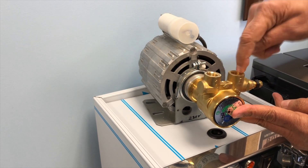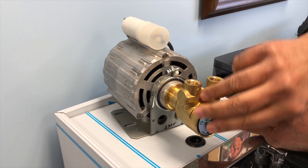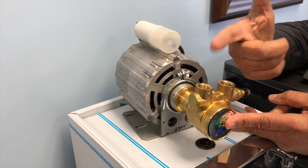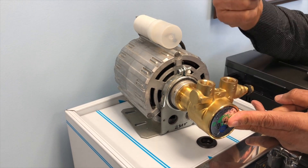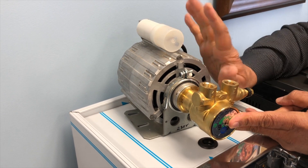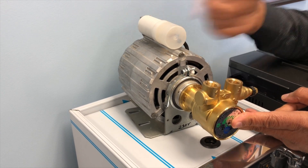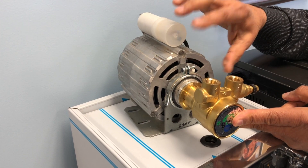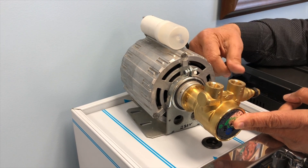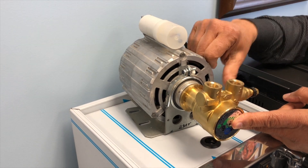One side is the inlet, the other side is the outlet. Inside the chamber there is a rotor to which five or six vanes are attached — they will turn and push the water and pump it into making espresso. This motor will operate on the same circuit as the solenoid valve which allows water to come into the machine, so as soon as the motor starts, the solenoid valve will open and allow the water in, either to fill the boiler or to make espresso.